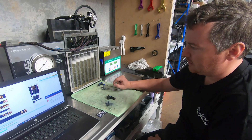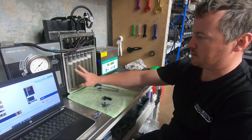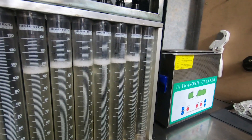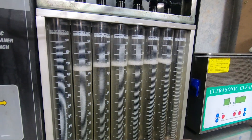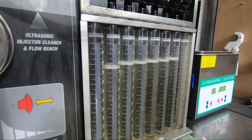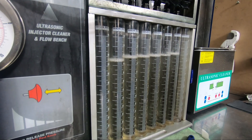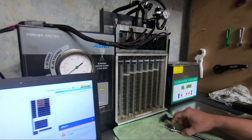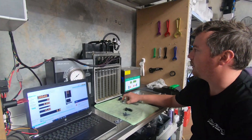As you can see, the blue ones flow less than the yellow, which flow less than the red — consistent with what Bosch claims at 100%. However, on these two blue ones straight out of the box, there is about a 3.5% difference. Bosch claims less than two percent, which is not incorrect — but this is at a specific condition.